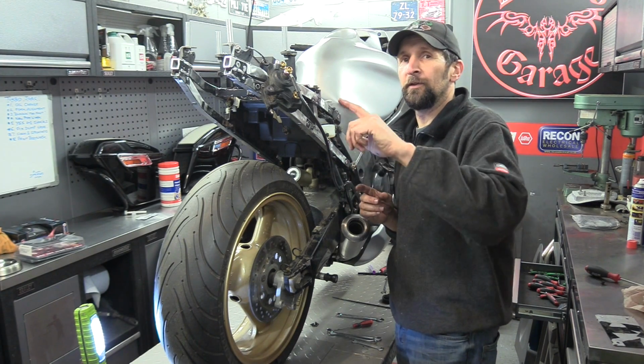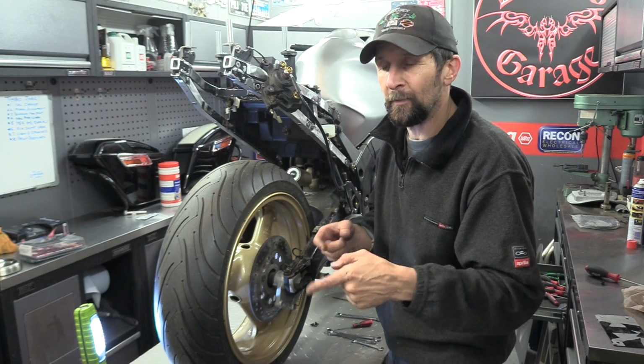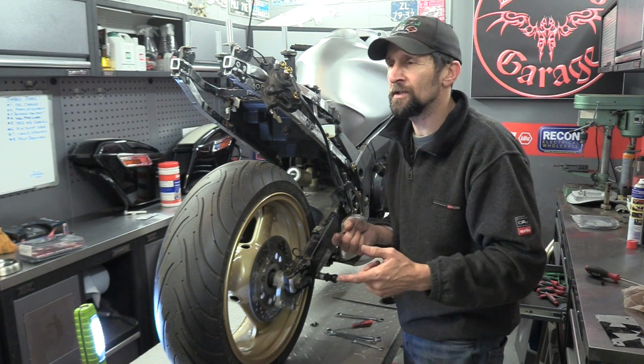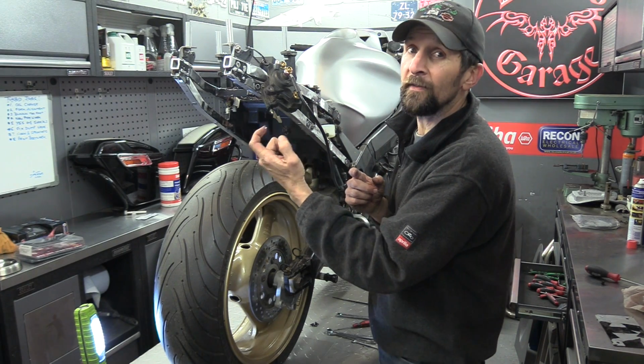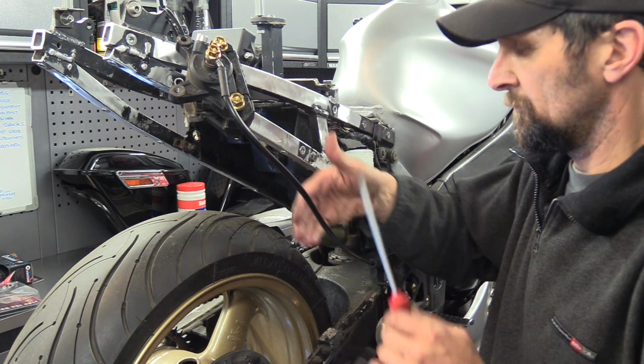And then one more bleed through will mean that I'm not forcing those bubbles downhill and then every time I stop, they're creeping back uphill. So you're squeezing them back and forth, chasing your tail around in circles. So let's leave that half an hour, I'll come back and we will definitely get a chunk more air out of that in a minute.